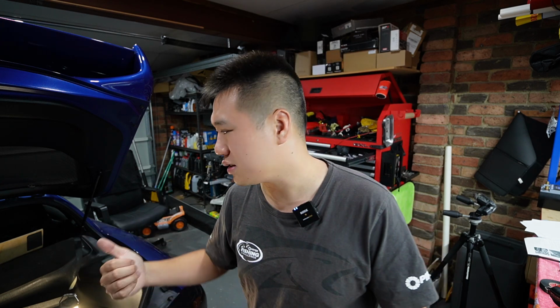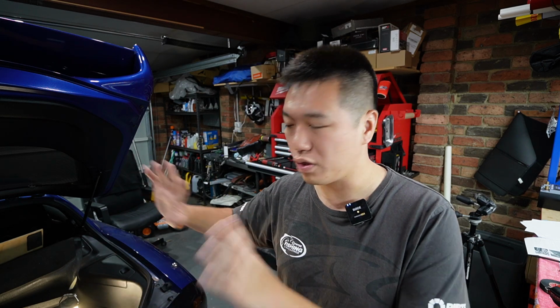So tomorrow morning, we're probably going to go to this Cars and Coffee meet, and if I do, I will bring you guys along. But the FD fuel system upgrade is complete. At the front, we upgraded the injectors to the 2600s with the Raceonly Billet Goodness fuel rail. I love the billet parts. And at the back, we upgraded to the Walbro 525 fuel pump, and we added a surge tank just to be track safe. And I want to give a shout out to Omar from Raceonly for being super helpful with all the feedback and advice on this car.